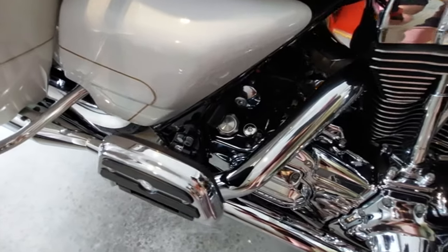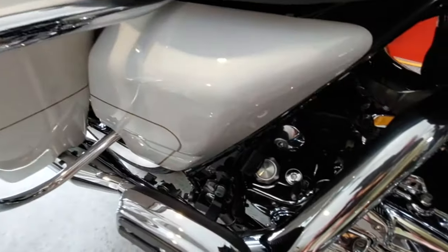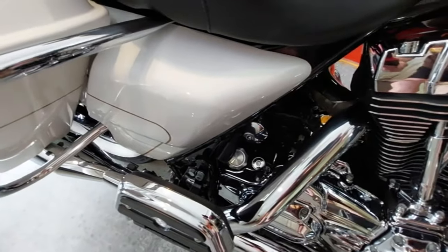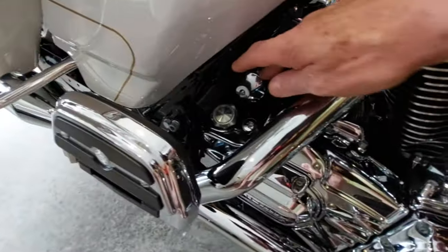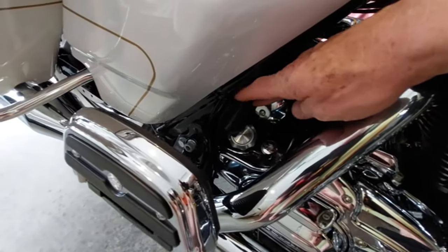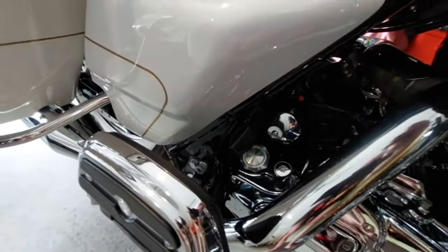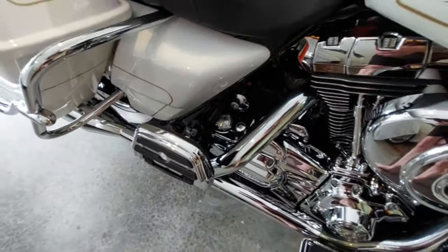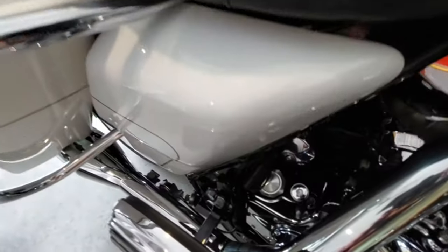Just seeing these here — those are the two oil filler caps for the engine and the gearbox. I've done a three-hole oil change on both bikes, this one and the Road King. That means the gearbox small plug, engine oil larger plug, and on the other side the primary drive, plus a new oil filter at the front. I've also added a plug for the harness, which you can plug a battery tender into — or the reason I got it was I've just bought a small travel air compressor pump from Harley-Davidson, so that's where it needs to plug in.